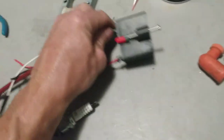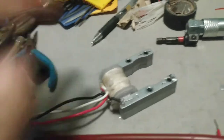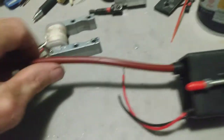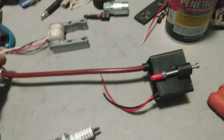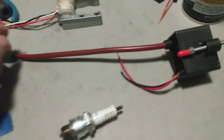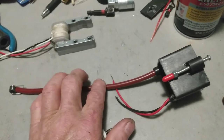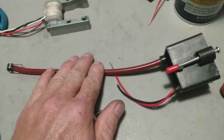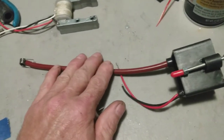I'm not sure about this ignition, but when I had this on there, this came bad from the factory — this was the factory one. I wasn't getting spark, so I went ahead and, with the purchase of this, since these parts aren't so expensive, I bought the $20 supercharged ignition system. I'm kind of thinking this one might have a little bit more variation in the timing, because a guy clocked me at 50 with this ignition on. With the new ignition, I've been clocked at 42, 43 with the GPS.